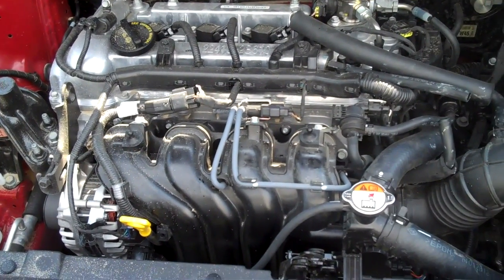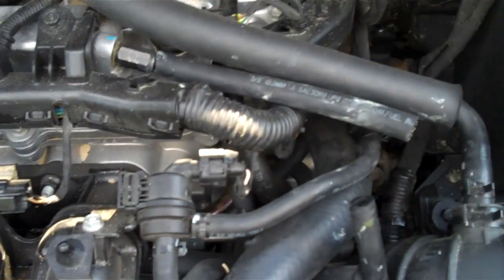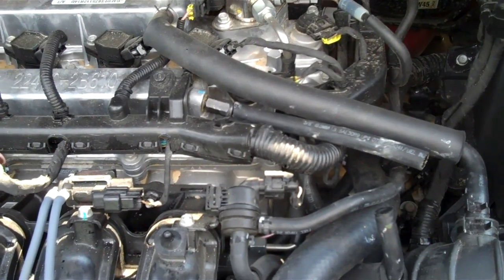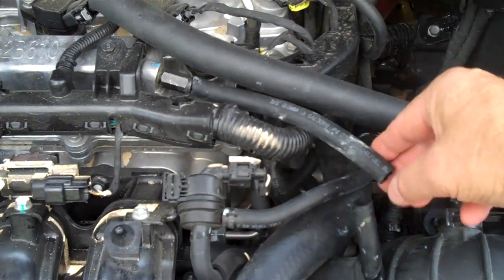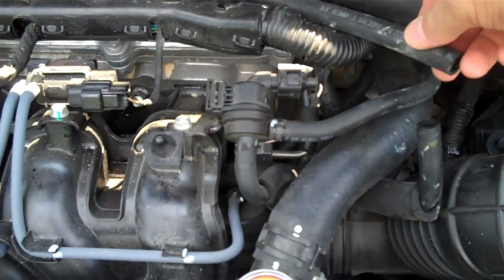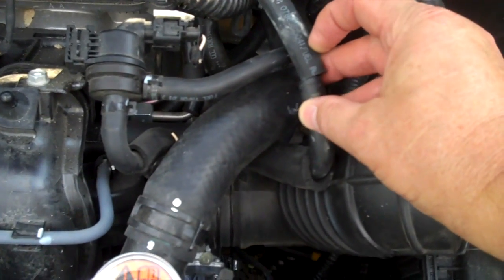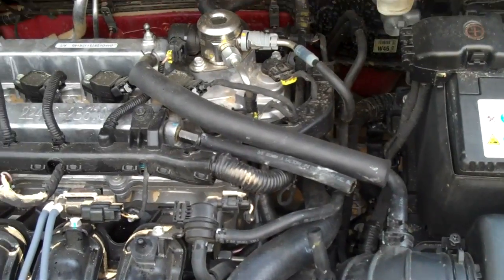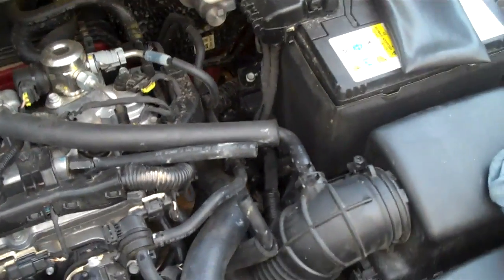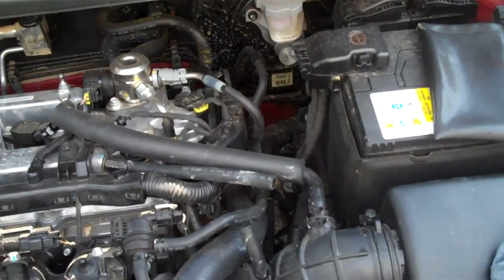Here's the 1.6-liter engine for the 2014 Kia Rio and other years as well. The oil-air separator goes into the PCV line here — this was all one piece from the factory. It comes out of the PCV valve, goes through this hose, carries along here and goes into the intake manifold down there. It's constantly recirculating oil which ends up getting on the underside of the valves, which never get cleansed with gasoline. It eventually builds up carbon and crud and will hamper the performance and fuel economy of the car.